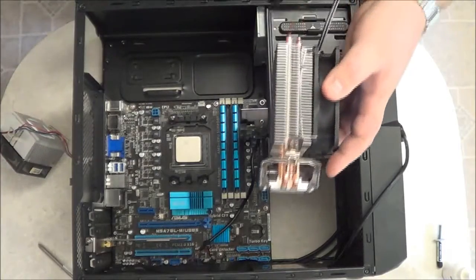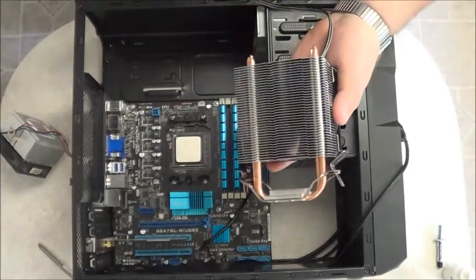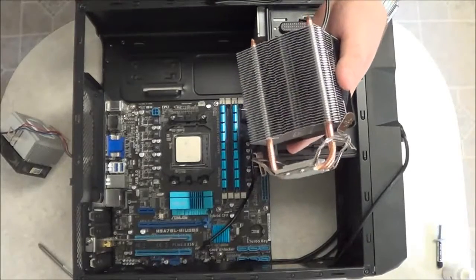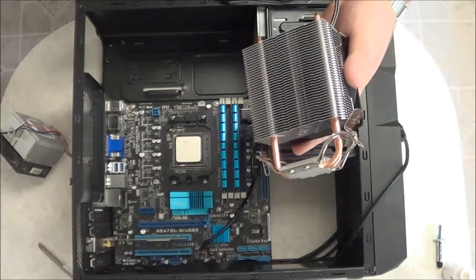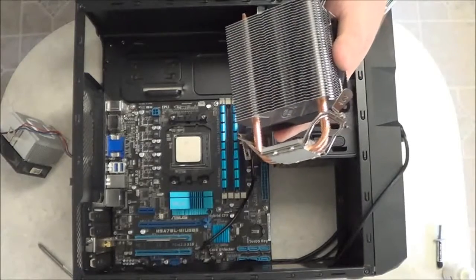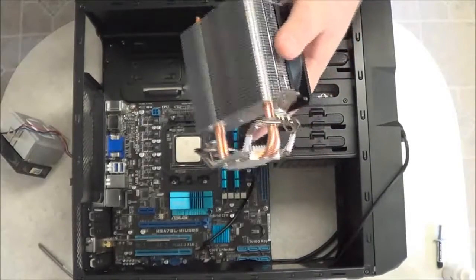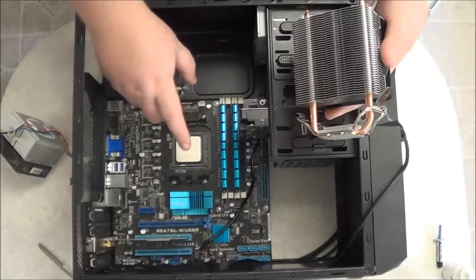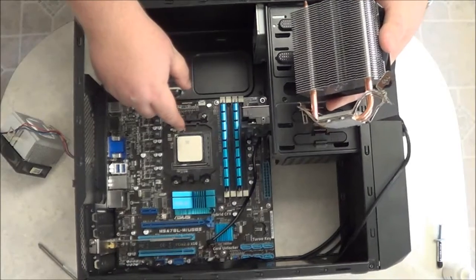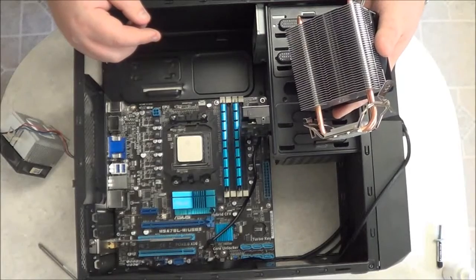So what I'm going to do is install this heat sink. You can buy these in kits, and most processors will come with their own heat sink. But when you purchase bare-bone kits, make sure whether it comes with a fan or heat sink or not. If it does not, you need to purchase a heat sink that will work with the specific model, because they vary between AMD processors and Intel processors. Make sure you get the correct heat sink for that particular brand.